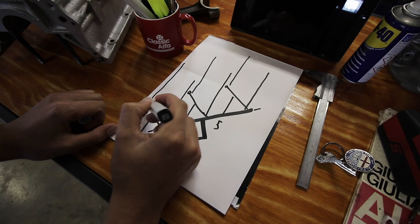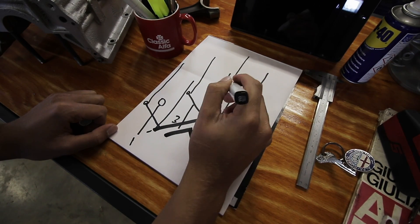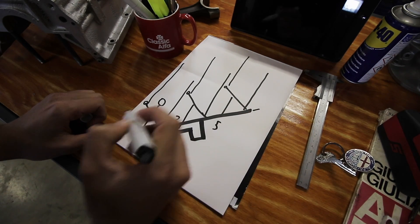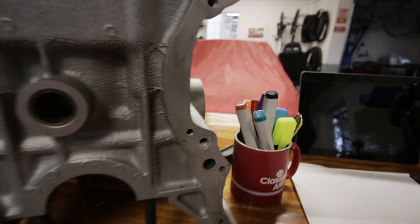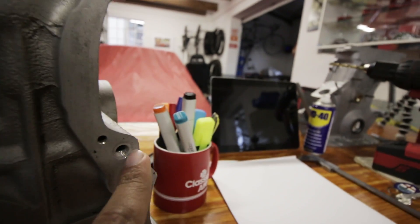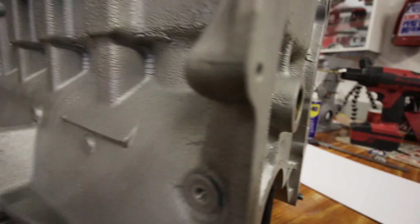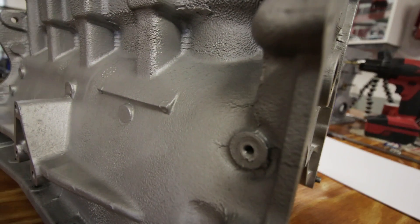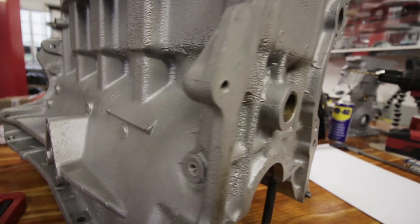What I'm going to do is drill out the aluminium plugs that the factory put in, and tap the block and put stainless steel machine screws in there, and grub screws here to block out the oilways when we're done. This means I can clean out the oilways and always have access to them if I ever need to bead blast the block again. I was in here last night just playing around with this, and I drilled out the front of the main oil passageway on the exhaust side of the block, and I threaded the end, and I did the same for one of the ones on the side. So I've got three more holes to make, and then we can clean this thing out.